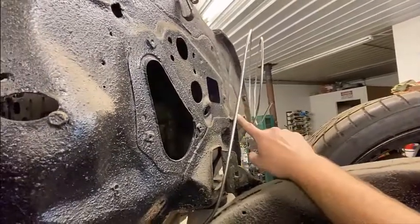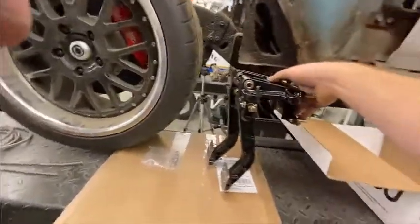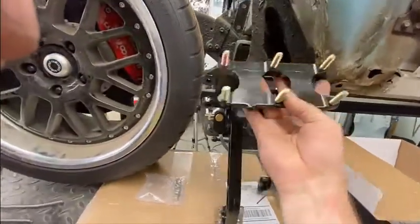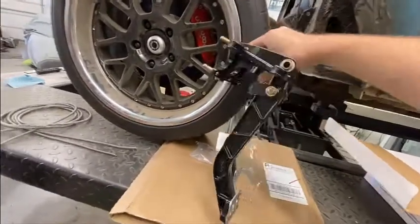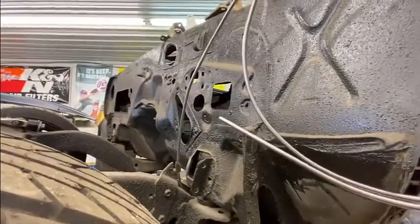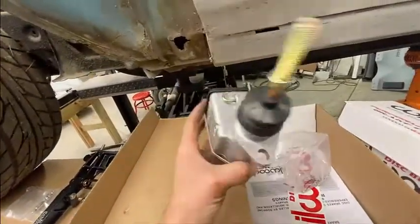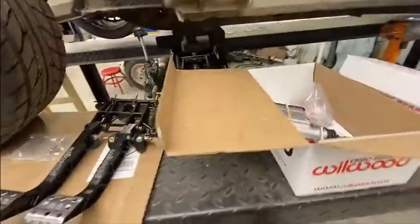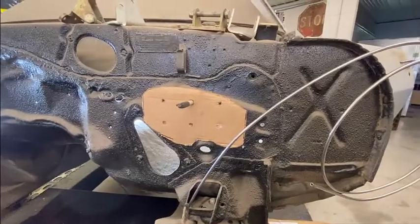I can't trim this until I've got the pedal assembly in, which is going to be another custom piece. So I'm going to start on that next. This is what the pedal assembly looks like when put together - it will mount to the firewall like so. When you do that, the pedals will hang down. I'll drill the holes to mount the plate up there, and on the other side of those will be these - the master cylinders: one for the clutch, one for the front, one for the rear.